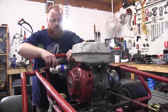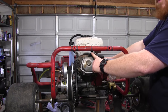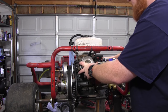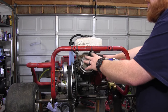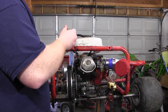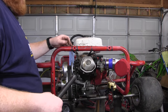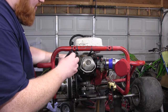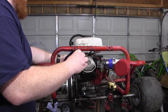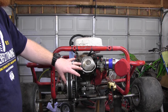Now I'm putting the fuel line on the carburetor and tensioning the motor up to figure out how I want to do that exhaust. Looks like the chain's tensioned up right there, but I don't like that this spark plug wire is hitting the frame. What I'm probably going to do is take one more link out of this chain so I can set the motor a little bit more forward — I don't want that interfering with anything. That could also let that exhaust pipe fit, because no matter what we do this exhaust pipe is definitely not going to work as-is.